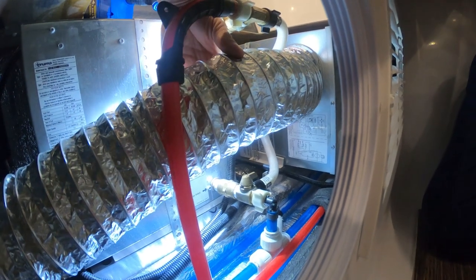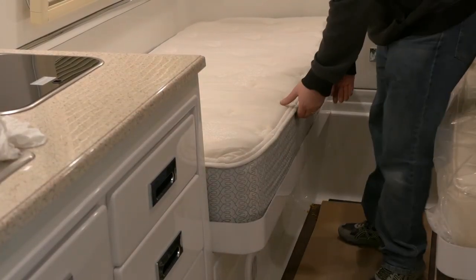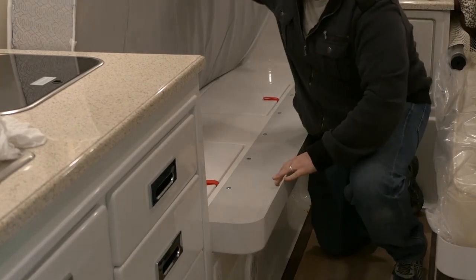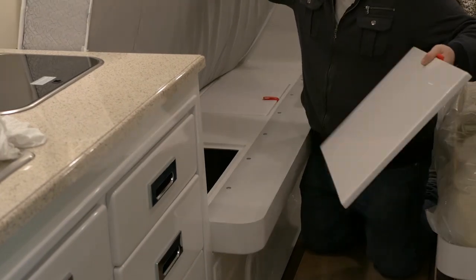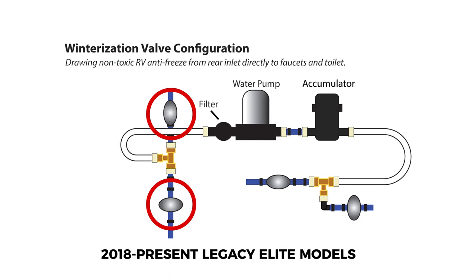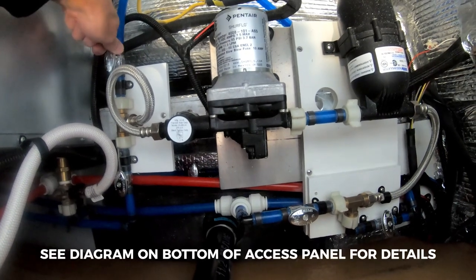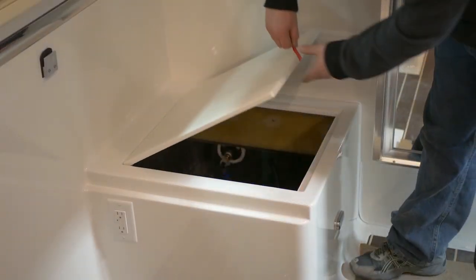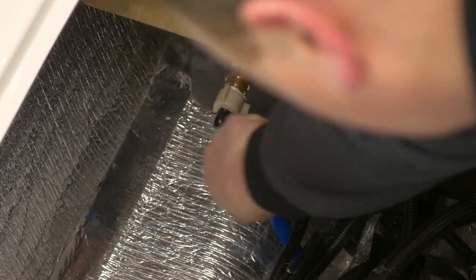Next, you will need to configure the water pump valves, which will allow you to pump RV antifreeze into the plumbing system from the inlet at the rear of the travel trailer. You will find the pump and the valves inside the camper under the curbside bed or seating area. To configure the valves for winterization on Legacy Elite models, turn the two valves on the left opposite of what they are in normal valve configuration. If your trailer is equipped with a black tank flush valve, open the valve under the right dinette seat.